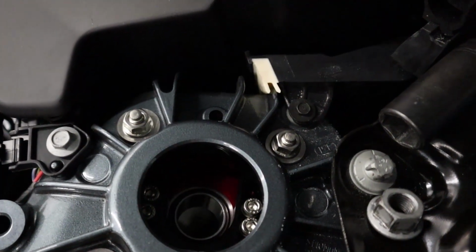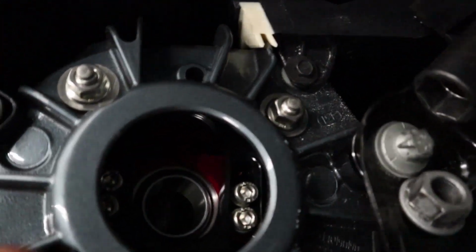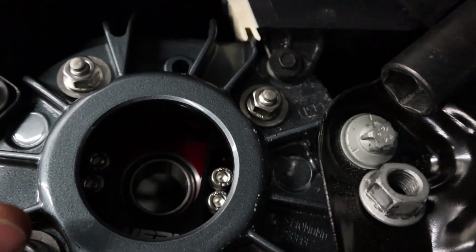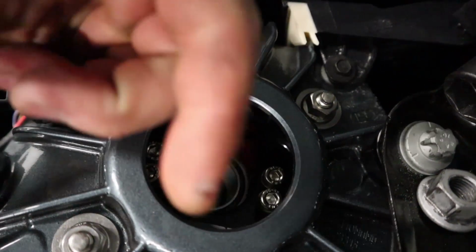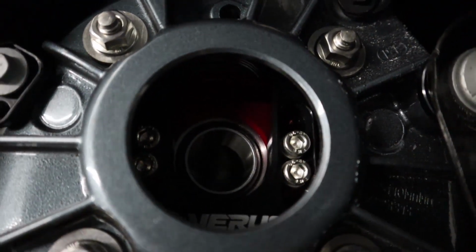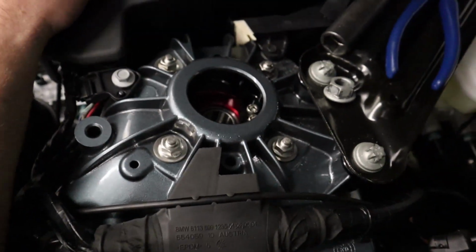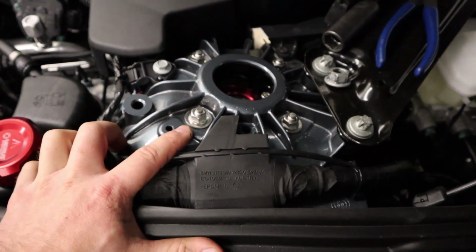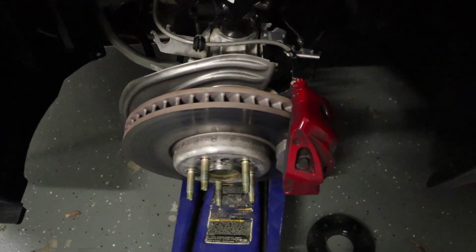All right, so at this point I have installed the camber plate with the adjuster installed loosely with the M6 socket-headed cap screws. It's in factory position, which is all the way this way. But that's beside the point, because right now it's very loose. That's installed into the chassis with the supplied M8 nuts and washers. And then I have the entire knuckle assembly on a jack.